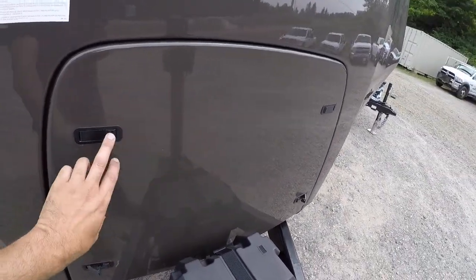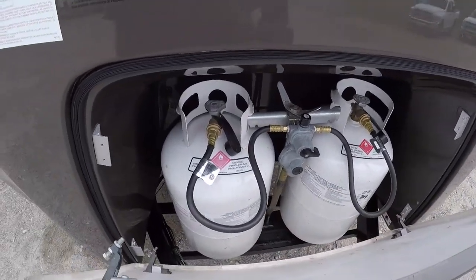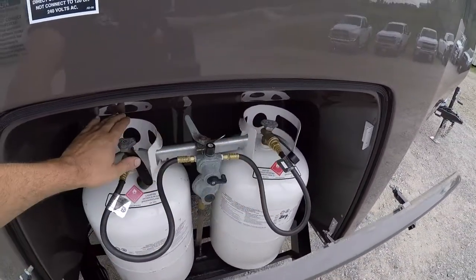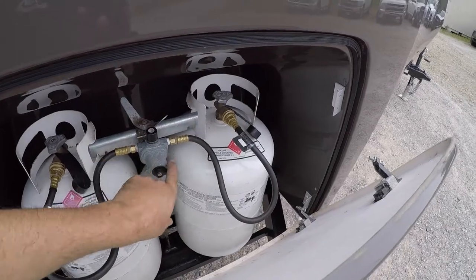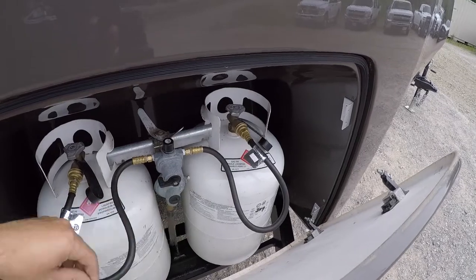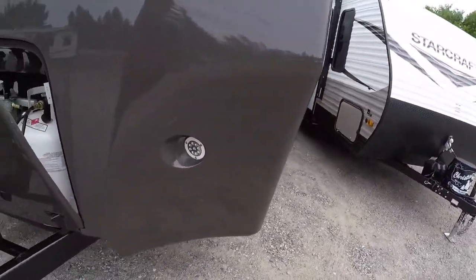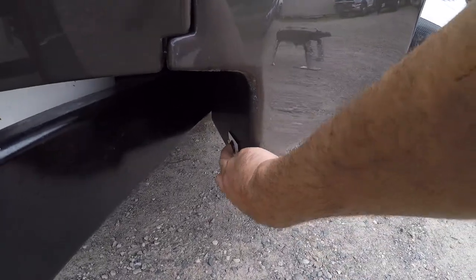Behind this, four buttons on each corner — that opens up and that's your propane tanks. You have two 30-pound propane tanks and a dual crossover regulator. What this does is allows you to open both tanks; when one empties it will automatically switch over to the other and start using that propane. When you notice one is empty, you can flick the switch, take the hose off, bring the tank in, get it filled, and put it back on. Once this one is empty it will switch back over, and vice versa. You also have LED lights here on the front — there's a switch just below for those.